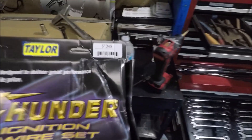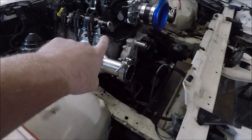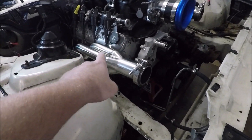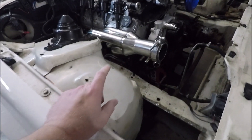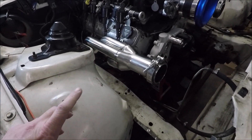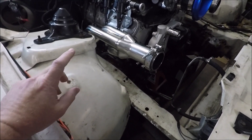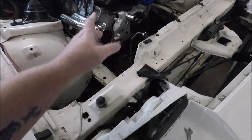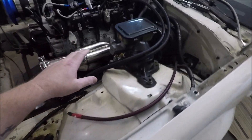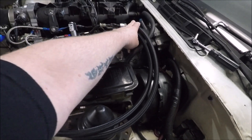The problem we had is with our up-and-over turbo headers — the wires were so long they were bulging out, just all over the headers. Obviously they would have melted. Even using heat sleeves on them, they were being pressed so hard against the header I was afraid they would eventually burn even through the heat sleeves. I tried to space the rails up, but in order to get the rail spaced up far enough to stretch the wires out straight, I ran into the problem where I was hitting the fuel pressure regulator and my fuel lines over here on the driver's side.